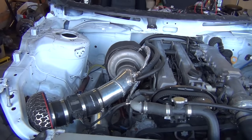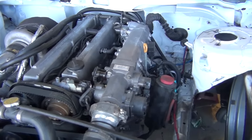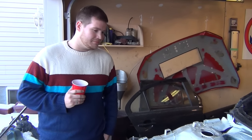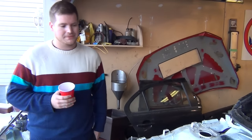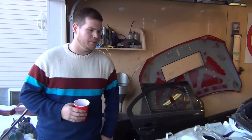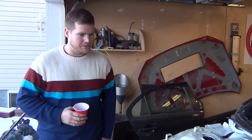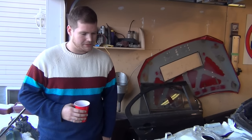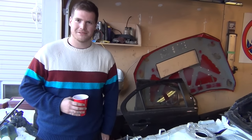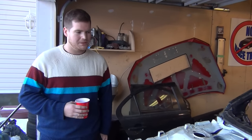So the question that everyone always has: why 1JZ and not 2JZ? There's multiple reasons. It could be just the pure height difference of the engine — there's about a half inch in height. The 2JZ is a little bit more of a torque monster, as it obviously has more displacement, so it'll build more torque. And with being purely rear wheel drive, I'd like to keep the torque down so I don't have to use traction control as much. Especially if I want to do events like autocross, torque is definitely not going to be in my favourites. The other reason is smaller displacement engines have quite a different sound to them, which I always enjoy.